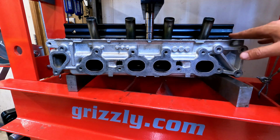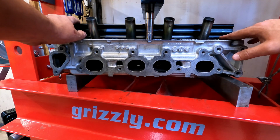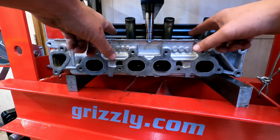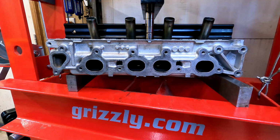It's a lot better. We went from, remember, being able to push down on the feeler gauge here and insert a, what was it, 25 thousandths feeler gauge, to now we're having trouble getting 2.5 thou in any more than just 1 or 2 places. I think it was here and in the middle, but that's inconsequential. We'll lock it down where it's at, and then I'll show you how it compares to how it was.